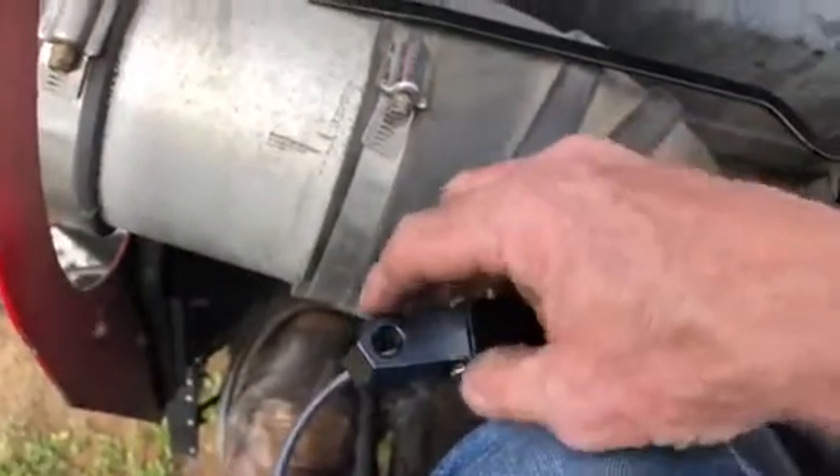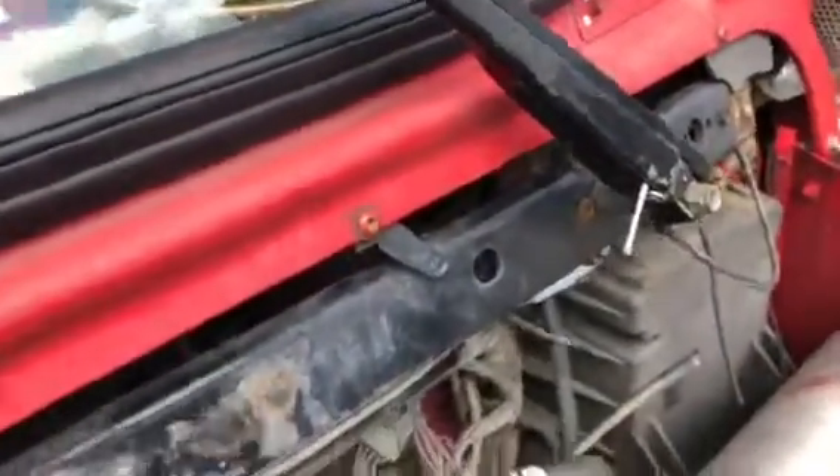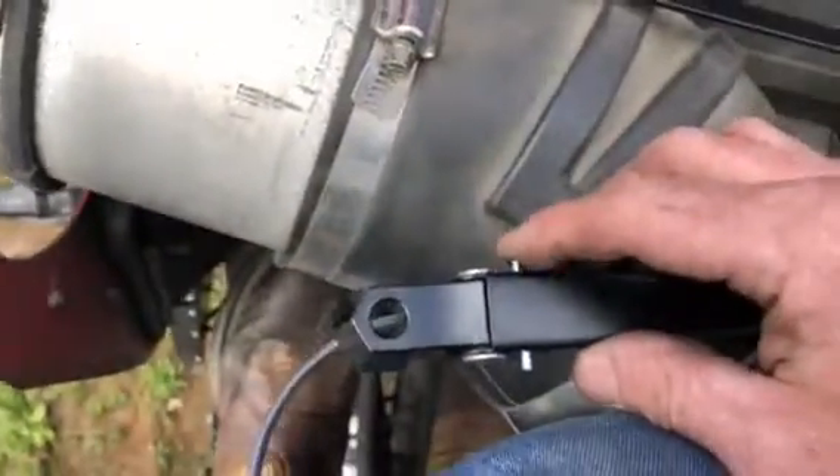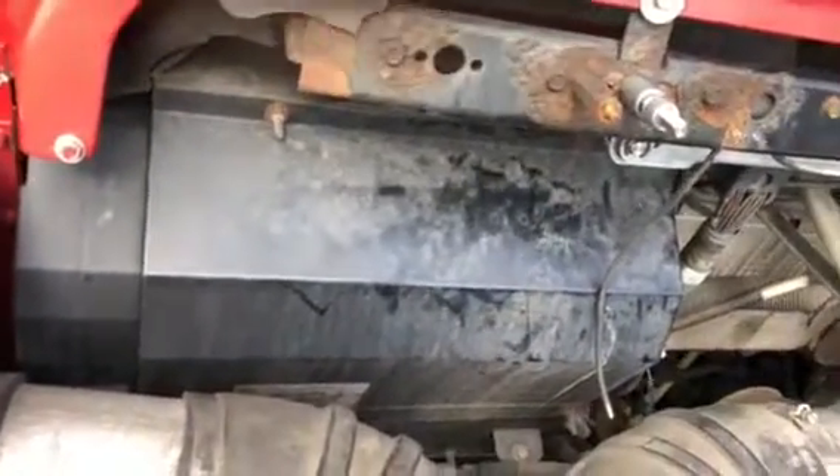That's what positions your windshield wiper arm. Your windshield wiper arm has a spring load right here and it will fold over. Take a cotter key and stick it right through there — this is a new one so it comes with a rod in it. You can stick a cotter key through there and it'll keep it straight. Make sure you do this so you can get it all the way on without stripping the threads. If you strip those threads, you're in a world of trouble, so make sure you get it right.